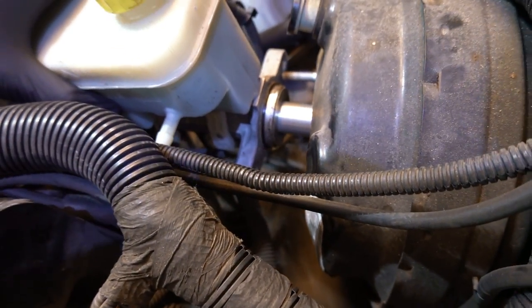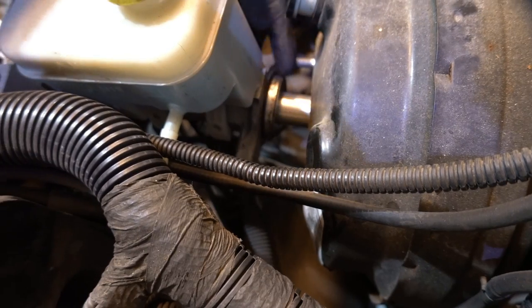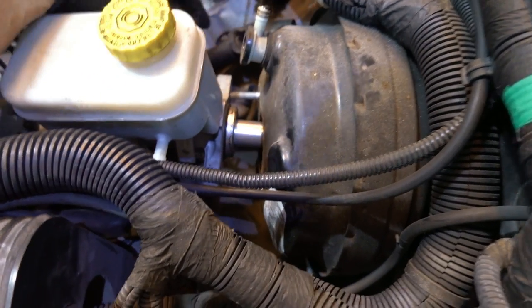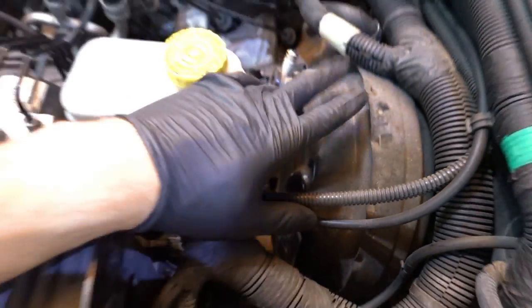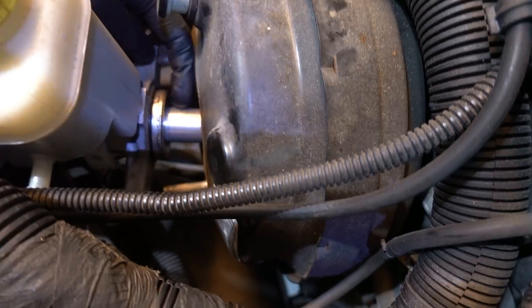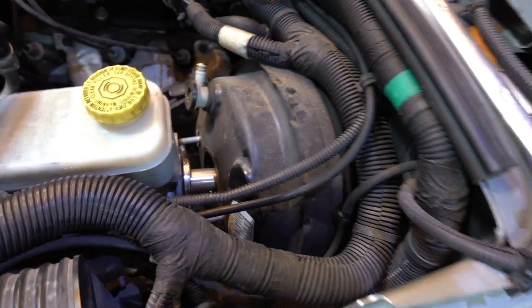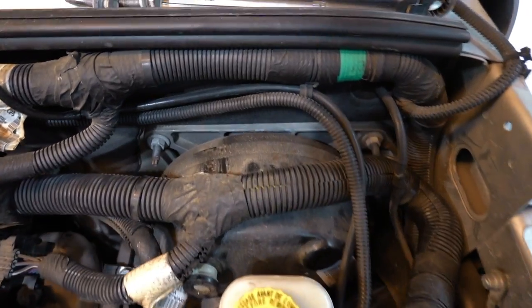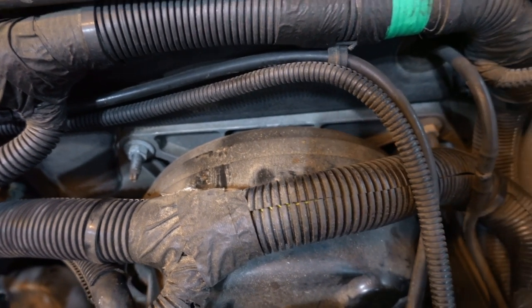You can see on the back of the master cylinder there is a rubber seal right here and we're going to be replacing that. When it goes bad, this whole thing will leak vacuum. The check valve goes bad, it'll leak vacuum. The seal goes bad, it'll leak vacuum. I'm pretty sure the booster has an internal leak and hopefully we can see that when I get it out. Got it all loose here and there's a little bit of brake fluid on there, which is normal - I just hope I don't see the booster full of brake fluid.